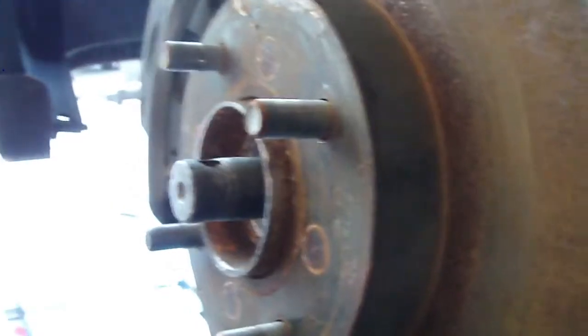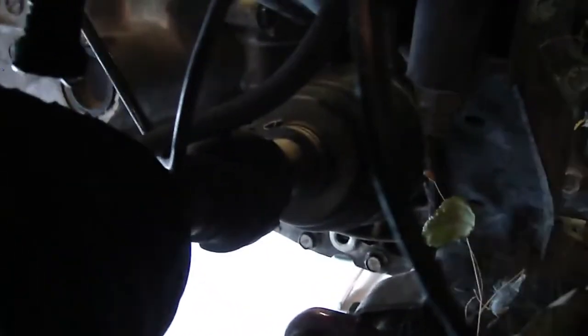Okay, guys, the driver's side axle is just as simple. It's actually easier. There's no axle bracket that holds it to the block. So just loosen your axle nut, remove these bolts, and slide out the axle. Pull it back towards you, and that's it. I won't record much on this side. This side's pretty straightforward, and I'm working in a very tight garage, and this is the side where there's not much room. So let me go ahead and take out this axle.